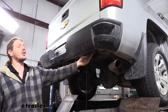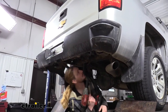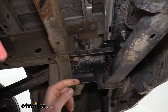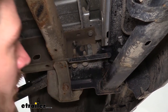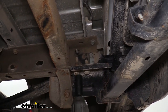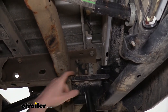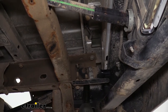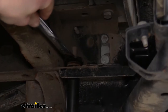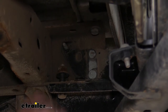Underneath, we'll need to take out bolts on each side of the frame where the bumper attaches to it. We'll use a 21mm socket and remove both of the bottom bolts where they go up into the frame. You don't have to worry about the bumper moving because it's still attached to the side of the frame and we don't need to touch that hardware. For the rear-most bolt you may need to hold it with a wrench. We're going to remove the ones on the other side as well.